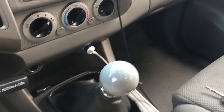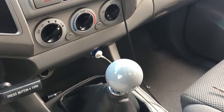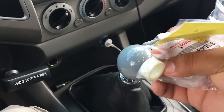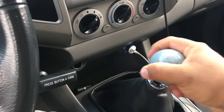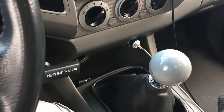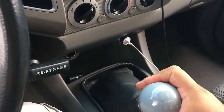What's up guys, Tally here with another video. If you ever notice that your shifter is starting to get a little sloppy, you might want to check one of these — the shifter rod bushing. It's a genuine part from Toyota. You change one of these and it should bring back the tightness of your gears. If the bushing is completely gone, replacing it will help you get into the gears way better. Mine's torn — I'll show you what it looks like in a bit.